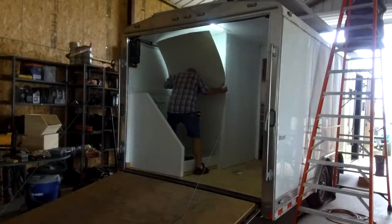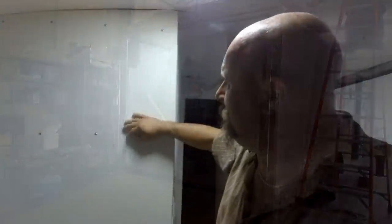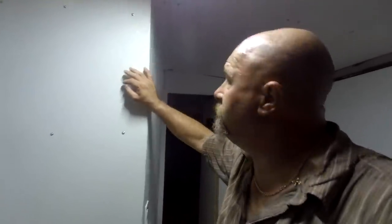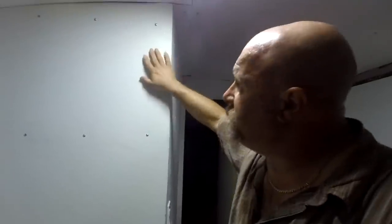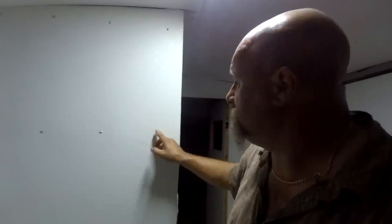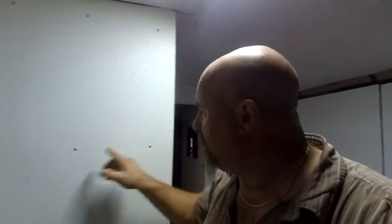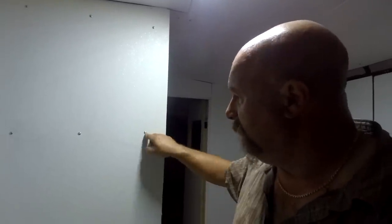I covered it — before I started this project, this trailer had this plastic in the roof. It's fiberglass reinforced plastic sheets, like the walls in the bathroom at McDonald's and Walmart's. I wouldn't have bought these but I already had them, so I went ahead and put them in. I had to cut them out and make them fit and trim, and I got all these screws in here. The holes were already in it from when I put it in the ceiling, so I had to put screws in these holes to cover them up. I'll pull them out later and put a little dab of caulking underneath and squish them back in to make it watertight. I don't really have to have it watertight because I'm going to have shower curtains on the inside — this is just extra protection in case the shower curtain opens and water splashes on the plywood.